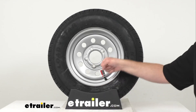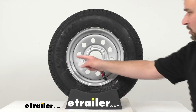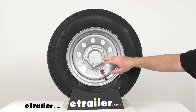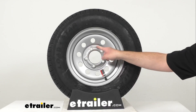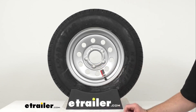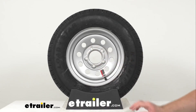This eliminates the need for the constant re-tightening of the lug nuts. The rim dimensions from bead seat: the bead seat is 13 inches in diameter and the wheel width is 4.5 inches. Our bolt pattern is 5 on 4.5 inches — that first number in the bolt pattern is the number of bolt holes and the second number is the diameter in inches of the circle in which the bolt holes sit.